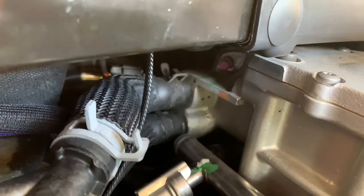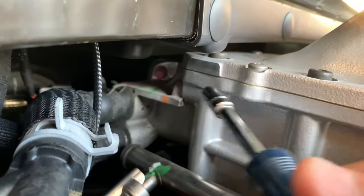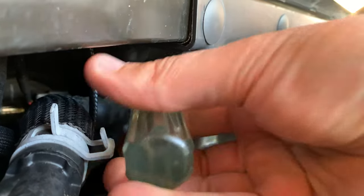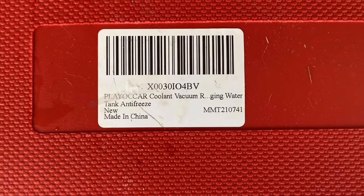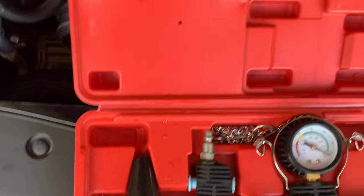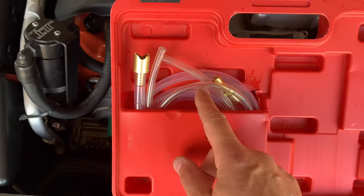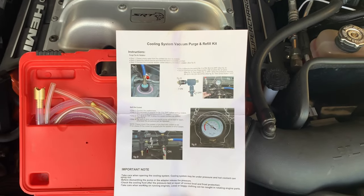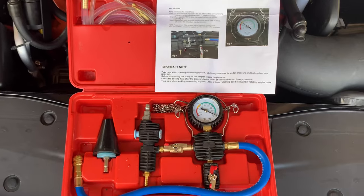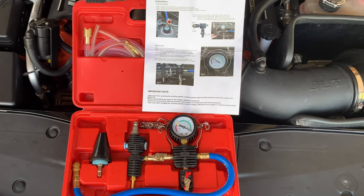It's kind of hard to see there, but yep — definitely coolant coming out. We've got no air pockets in there, so this worked absolutely fantastic. Just want to briefly show you this is the Playo car coolant vacuum that I used. The kit includes your gauges, your plunger, a couple of lines for residual and coolant, and also a very simple step-by-step instruction manual. They're very inexpensive and honestly take the headache out of problems like this. Hope this helped!